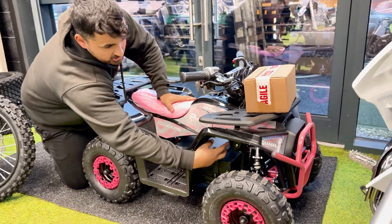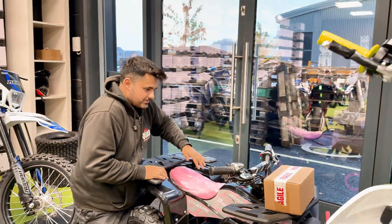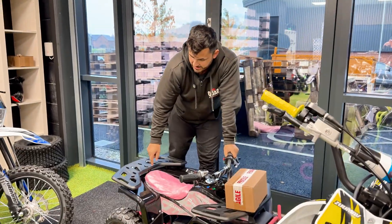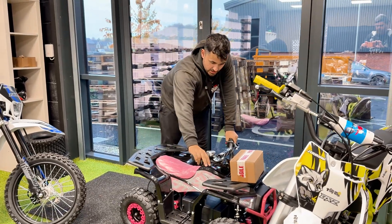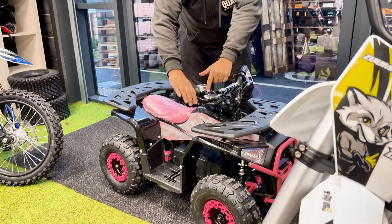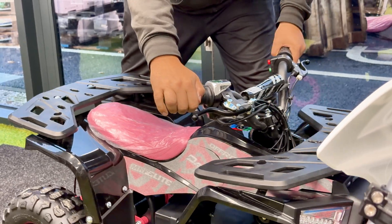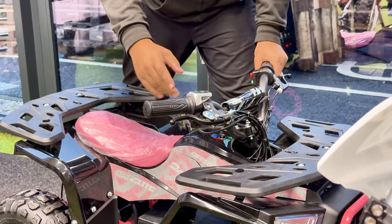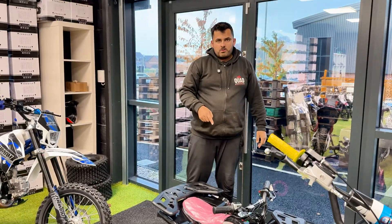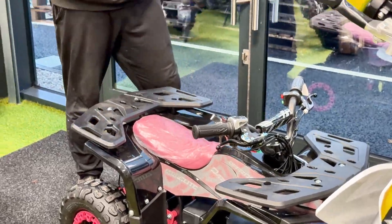A few other questions we always get asked: where does it charge? Under the seat, as you sit on it, it's on the right side of the keys — there's a little port there. Also, if you have to push it for any reason, don't push it whilst it's in forward or reverse — it wears down the teeth on your sprocket, meaning you'll have to buy a new sprocket sooner. Another tip: the handbrake is pulled in and locked in. If you switch it on and it won't go, put it in forward — as soon as the handbrake is on it's a safety lock and locks everything off. So if you think it's not working, it could be something as simple as that. Finally, when you've got it and it's assembled, it needs a 12-hour boost charge — even if it says it's fully charged on your battery indicator on the throttle, put it on a 12-hour boost charge. Good to go.